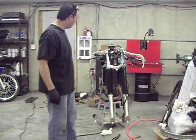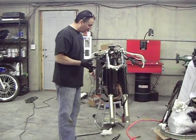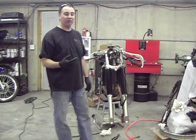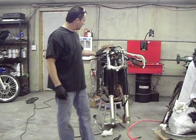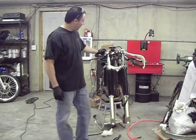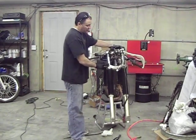We're done with the forks. We have taken them completely apart — new seals, new o-rings, new valving, low speed and high speed. We used a lighter fork oil fluid; the fork oil that was in it was 20 weight and we went to 5 weight. I've got some initial settings: 12 out on the compression, 10 out on the rebound as a starting point. We've also replaced the head tube bearings, and it's just so nice and smooth now — no ratcheting, nothing. It's just really nice and smooth.